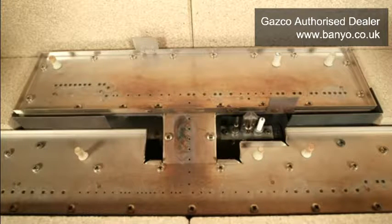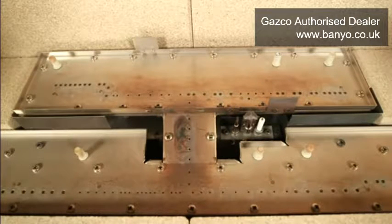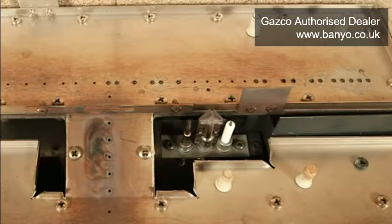It is very important that you remove any debris that is visible and that all burner ports are clear. You should also ensure that the pilot and the area immediately around it is clear as well, and check that the orientation of the pilot unit is correct. The unit should face the back of your appliance.